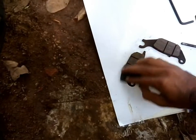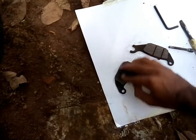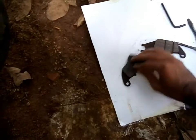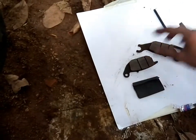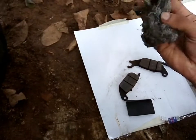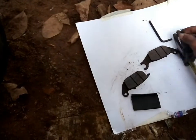I'm making it flat. I insist you use both your hands — I'm only using one hand because I'm holding the camera with the other. It's almost flat now. Wipe it with any clean waste cloth, and please make sure the cloth is not contaminated with any grease or oil, because that would affect your braking. The cloth must be perfectly dry, or else it would affect your braking.